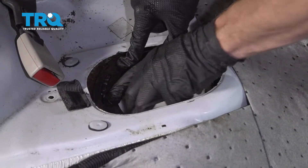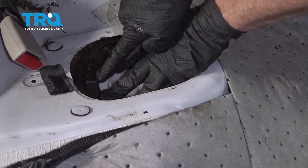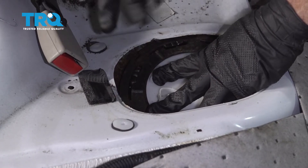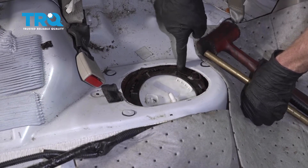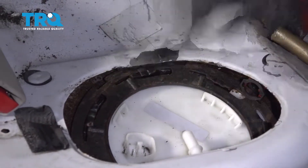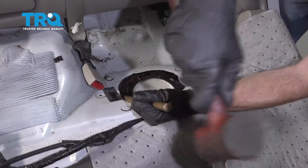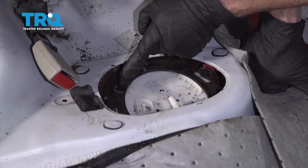Now grab your locking ring and carefully put it over this area. While pressing down on the pump, press the locking ring down so the tabs line up with the actual fuel tank. Now that all those tabs are lined up with their corresponding holes, continue on by turning this all the way clockwise until it's completely locked in. You can see some little bumps that come up on the locking ring — they need to line up with the bumps on the locking tabs on the fuel tank. Double-check to make sure all of the locking tabs on the fuel tank are sitting inside the ring where they belong. If one of them's out, it's gonna be sitting off kilter and not make a good seal. Drive this all the way around clockwise, then inspect all of these tabs and make sure they're lined up.